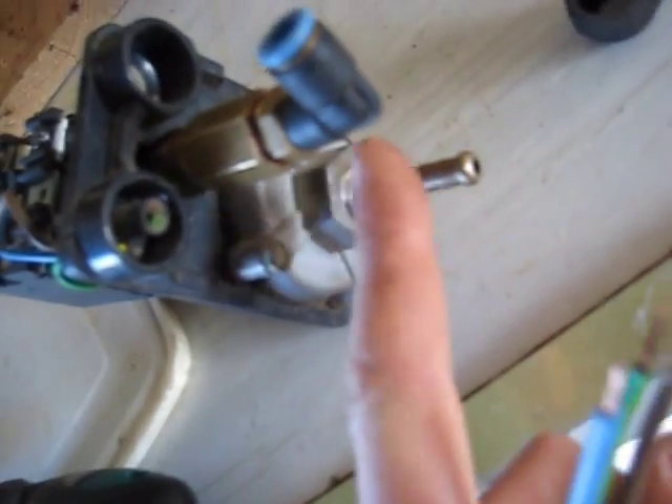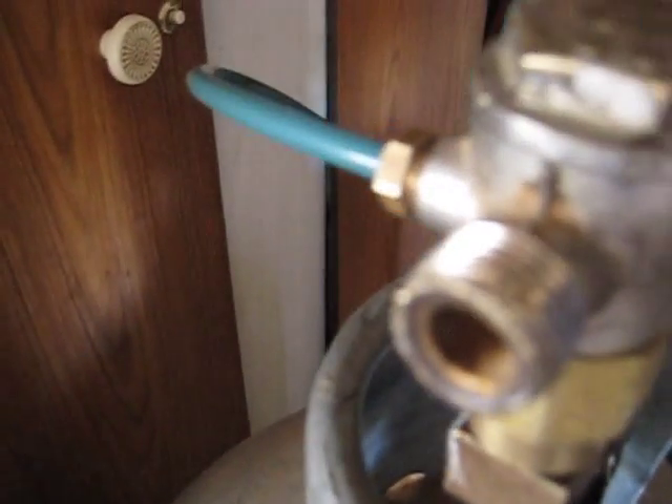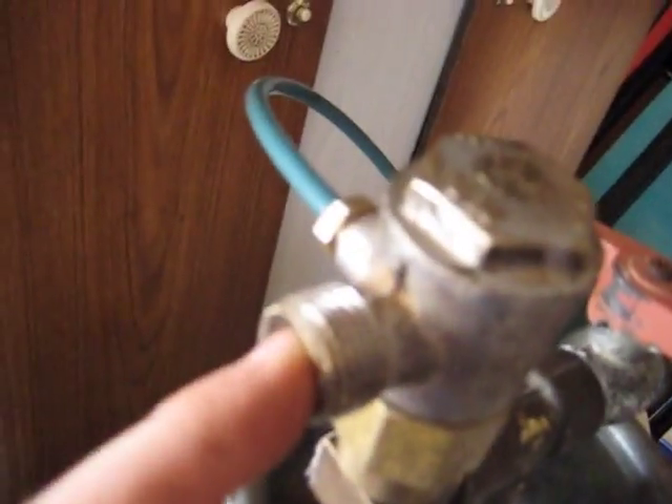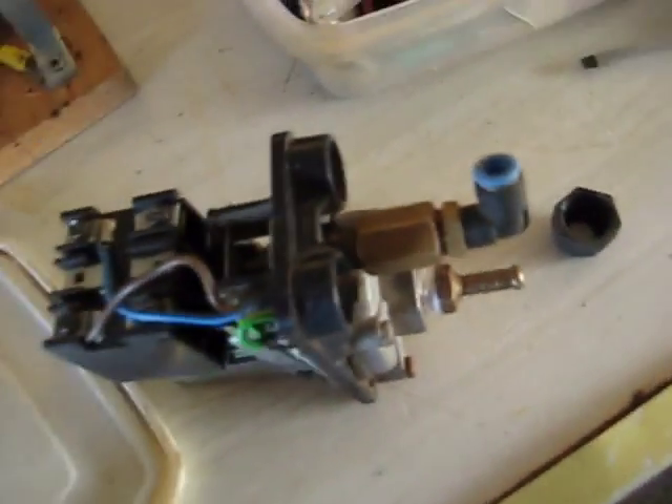I've got to find another way to fix that part. This half goes to the side of the outlet's side connection, so it relieves the pump when the pump stops pumping. The pump goes in through there, down at the tank, pushes a little lid up, allows the tank to fill up. And when the tank gets to the right pressure - whatever this switch is set for - that'll pop down. It'll push the air and relieve the head pressure through here. There's a low side and a high side: cut in, cut out. I'll wire this up and show you how I do it.